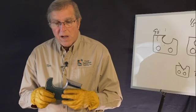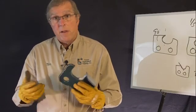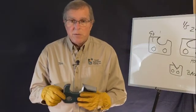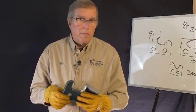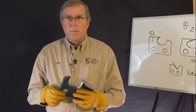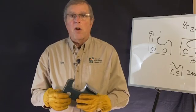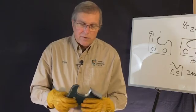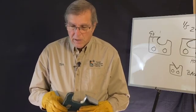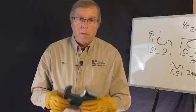A lot of people talk about grinder systems, and grinders are very effective. Every tooth that comes out of the factory is actually ground, but a lot of people don't prefer them to sharpen. And a lot of the reason is they go to pick up their saw chain they've had at the shop, and it comes back out and the tooth's half gone, it's all black and blue. They even try to sharpen it, and that's not the grinder, that's the grindee. And so when you start thinking through that a little bit, it actually goes back to the operator.